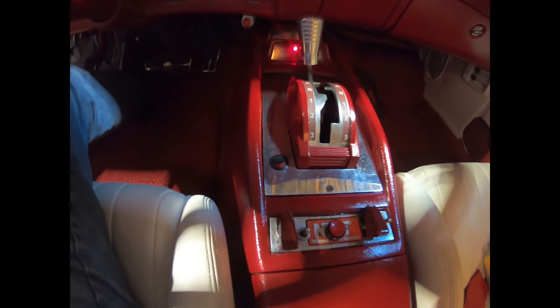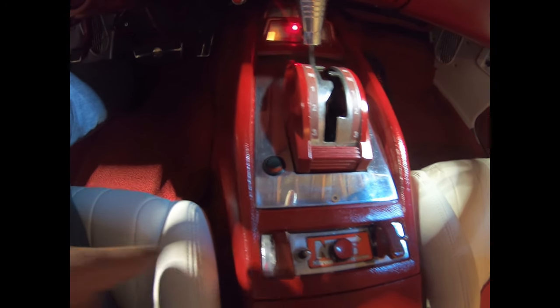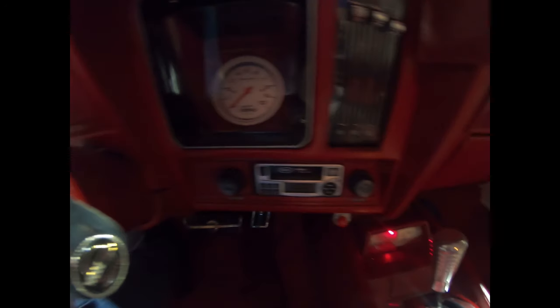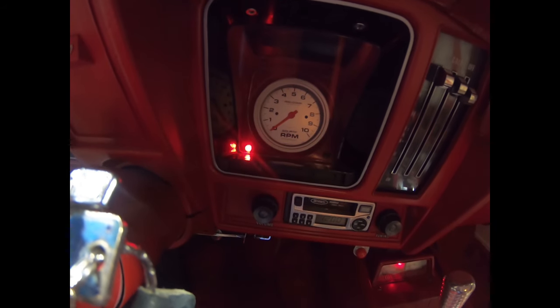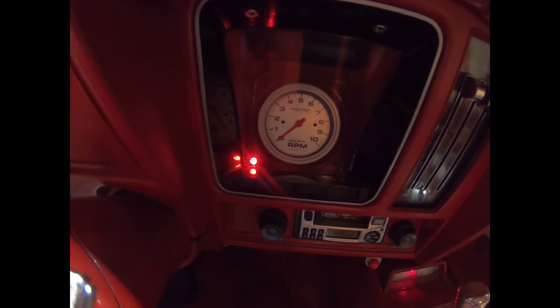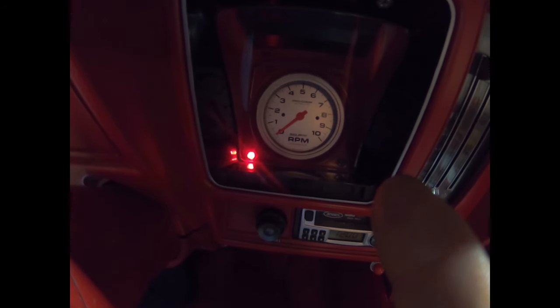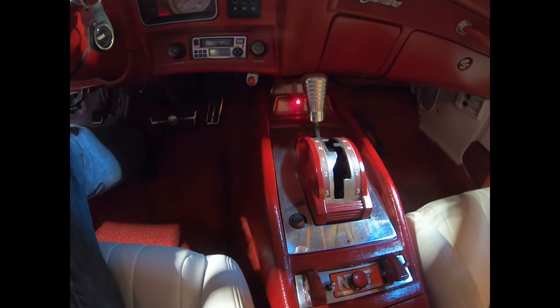All right, so we're wired up, I should say, not plumbed in. Here's our on off switch for the auto drive. There's our dimmer switch, which is the push button to manually turn on the overdrive. And there's where I put the indicator lights. Looking a little factory in there. And then there's a green one that'll come on the other side over here when you're actually running down the road, and the red one will go off. So that's pretty cool.